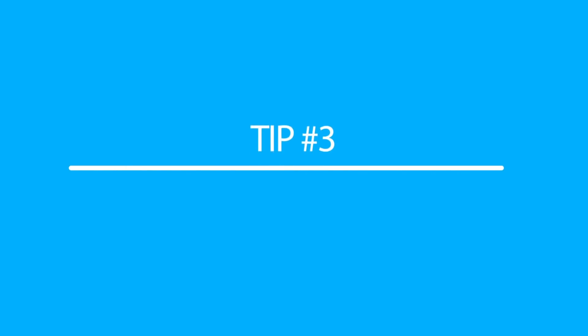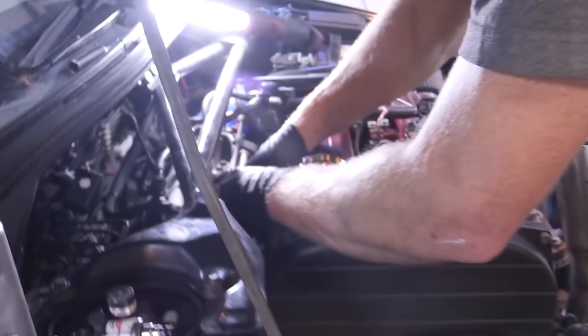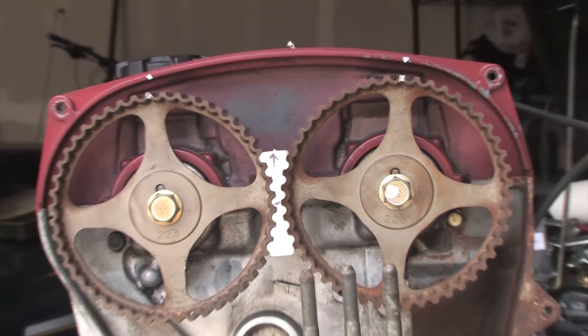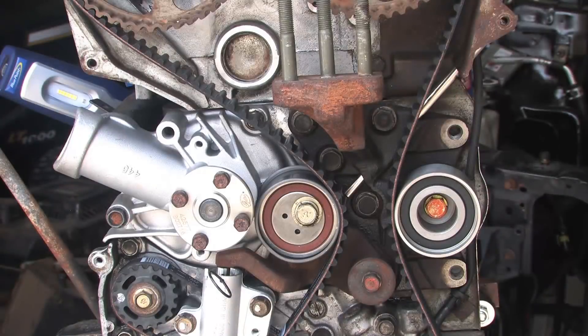Tip number three: maintenance before modifications. When you're first building the car, you might have big dreams of 700 or 800 horsepower and want to throw in a huge turbo. But I would suggest, for the sake of just getting the car running, that when you first start out, try not to do any huge modifications. Even when I built my roller, I picked up a set of stock injectors because I really just wanted to get the car in good running condition before starting major modifications. The less modifications you have in the beginning, the easier and smoother it'll be to get the car going. And now is the best time to do maintenance items — it's a lot easier to do a timing belt job with the engine already out of the car. Do things like timing belt and fluid changes now while it's easier, even if the cost adds up a little bit. It should be worth it, especially if you plan on keeping the car for a long time.